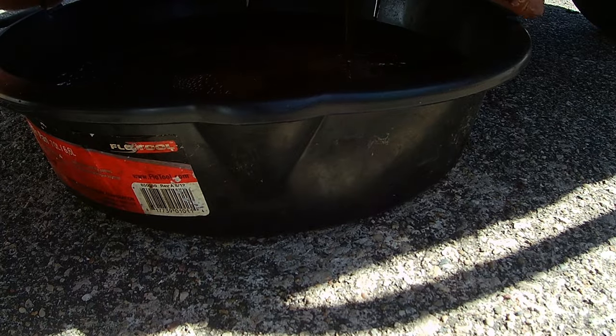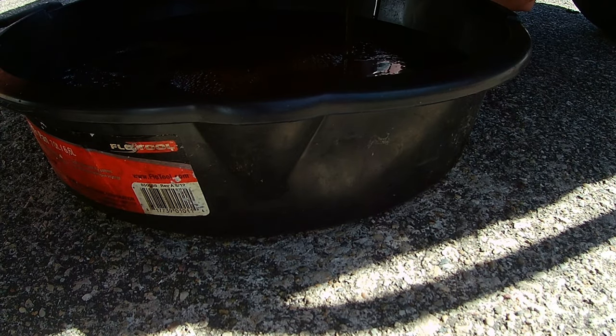I've always done the rule of thumb: every season change all three oils. Can't forget to change those O-rings on your drain plugs. We got the transmission drain and the engine oil drain done — now we got to head on to the primary and then pull the oil filter.